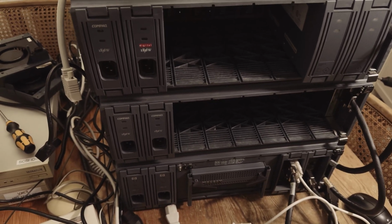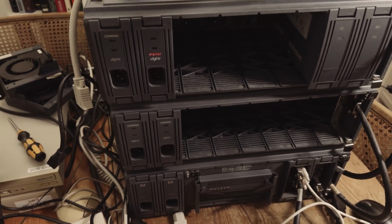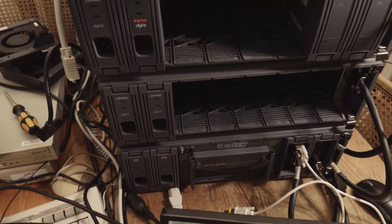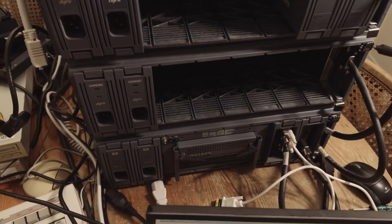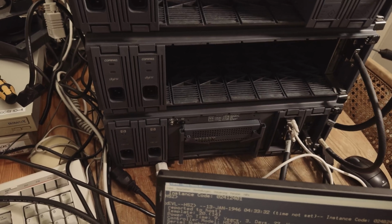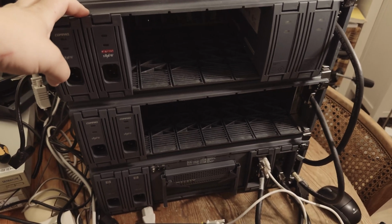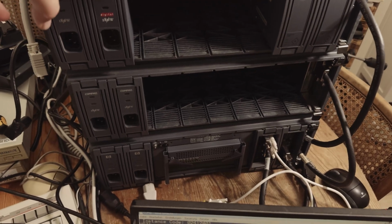When I try to make an operation on the disks, you can see hundreds or thousands of error messages because of the synchronization between the host and the controller. But the controller host indicator is blinking when I try to do something. That's the reason why I won't use this HSZ22, because it wouldn't work.